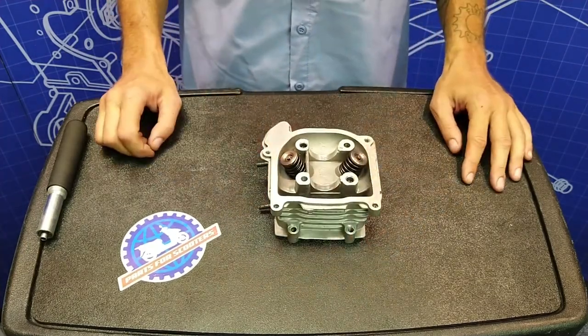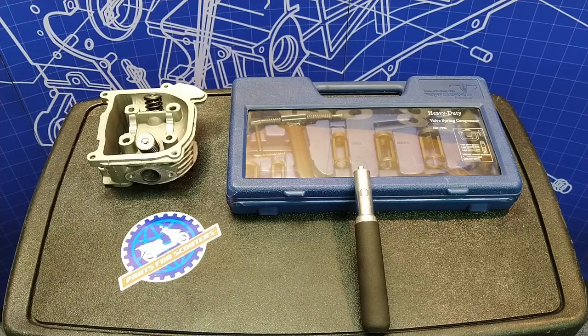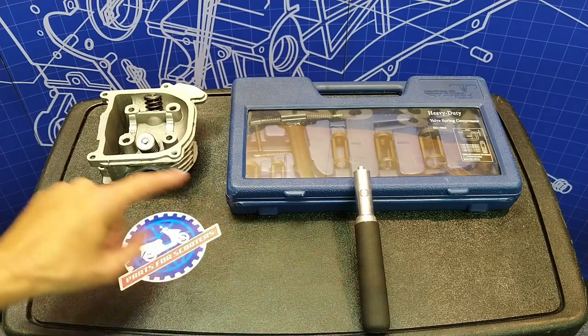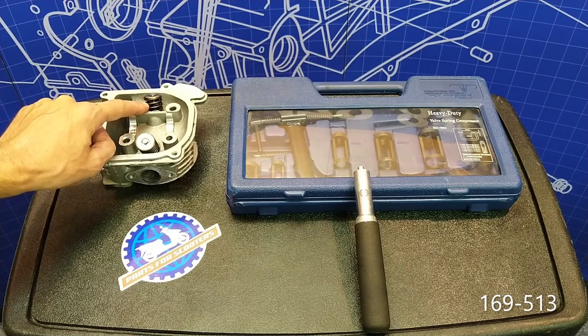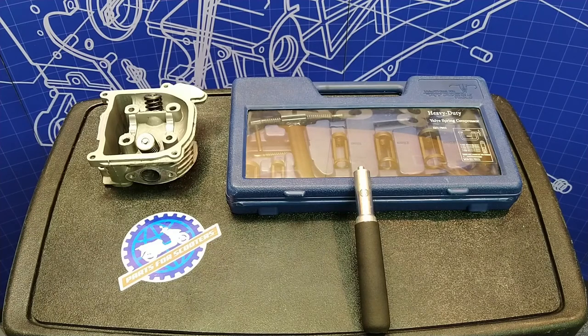As you can see, we are ready to install this and put our aftermarket performance cam on to really unleash the power. The stuff you saw in this video: the Pit Posse valve spring compressor tool, the universal parts multi-valve tool, titanium valve retainers, RDR 12,000 RPM valve springs, and the SSPG Viton valve seals. I hope this video helps you in the future — if you liked it, give us a thumbs up, click subscribe, and drop any comments below. We look forward to helping you out. Thanks.